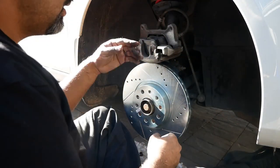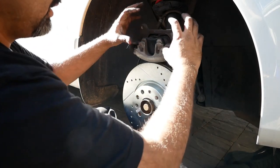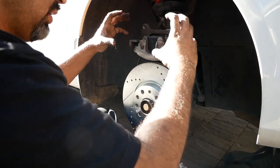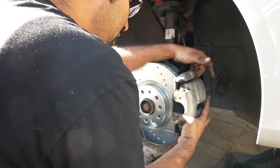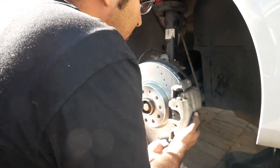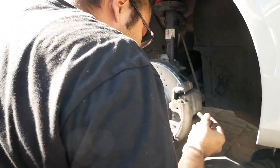We actually had to take off the retaining spring — I forgot that the retaining spring holds the pad height, so if you don't remove it first it won't give you enough clearance to pop the pad in. But once you do that, the pad should fit in. It's a snug fit — line up your rotor and get ready.